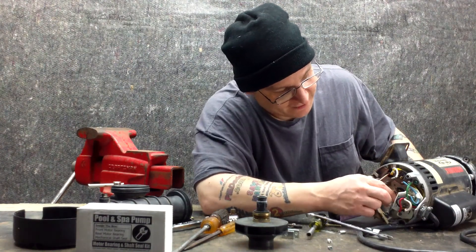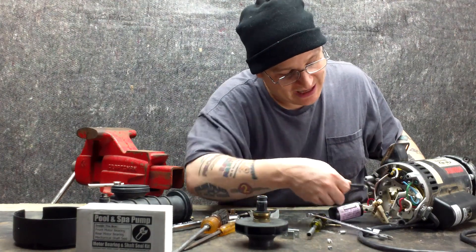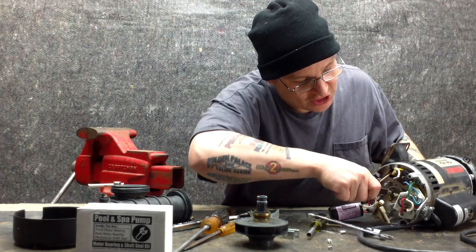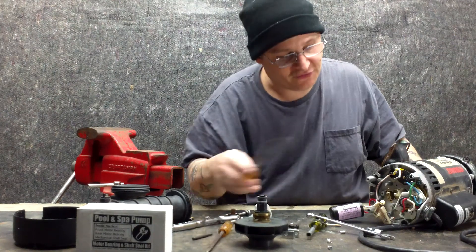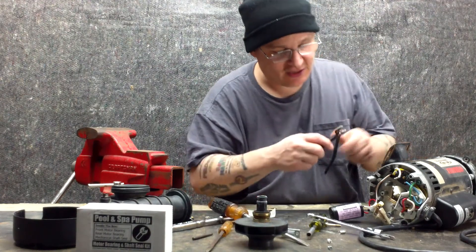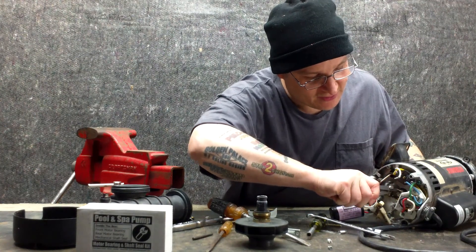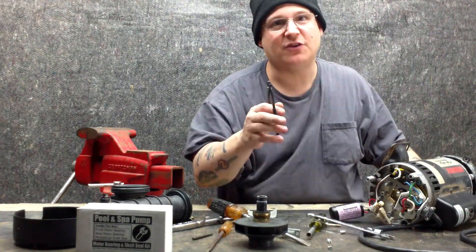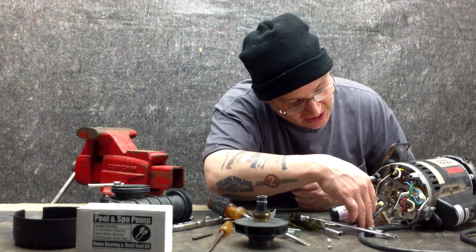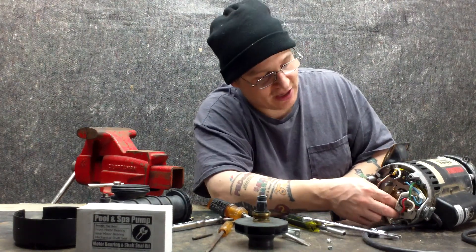Now you have the governor. Here's the governor arm — the flap. What you can do is just bend this piece a little bit, and then this piece will come out. Some people wedge it out, some people turn it out. You can also take a flathead screwdriver and bend it out. What I'm going to do is take my pair of channel locks and bend this arm a little — and once I bend the arm a little, that will allow the governor piece to come out. See that? It came out just like that. I have other videos — it's called the UST Motor Repair — that show you how to take this out up close.